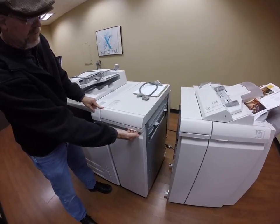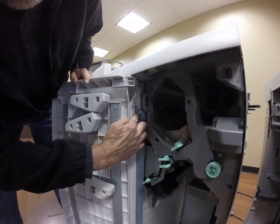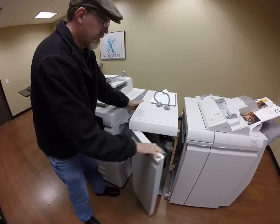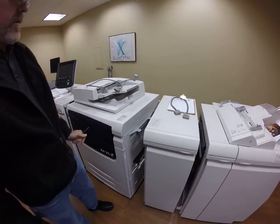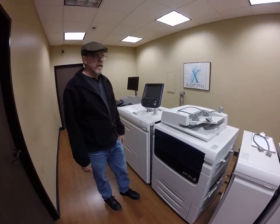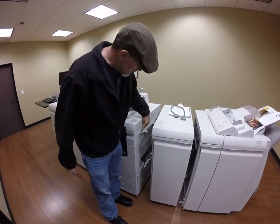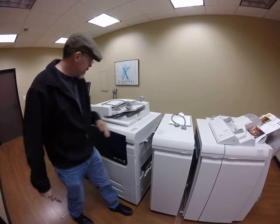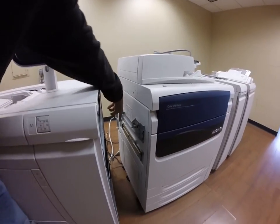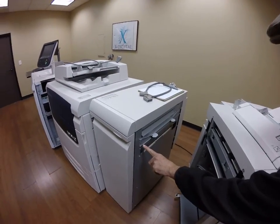Lastly, we're going to disconnect the interface module. We open up its door and it has a little lever right here — you put your finger behind it. Sometimes there's a screw right here holding it in place; you may have to remove that. We pull on that and it comes away. That'll undock everything you need so you can take off the brackets. These brackets can bend fairly easily, so you'll want to remove them — there are two screws for this bracket, and four screws for the other bracket. There's another bracket on the other side for the finisher with two screws as well.